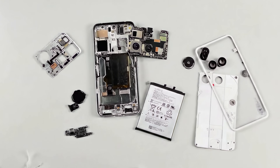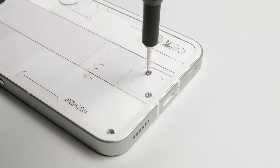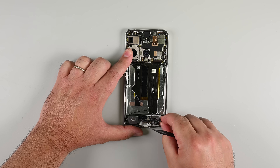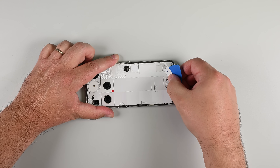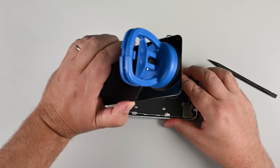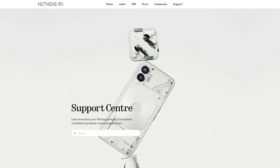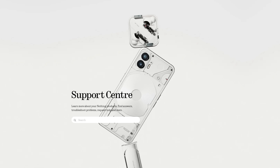At first glance, the Nothing Phone 3 seems like it would be a repair technician's dream. The team at Nothing loves to showcase the screws and components that make their devices, but repairability doesn't seem like a priority — it probably could be, and would align well with their unique designs. On the plus side, we have cameras, a USB-C port, and a battery that can be independently replaced. But on the downside, hidden screws covered by decorative stickers make disassembly visually destructive. The display and rear panel are secured only with glue and no clips, making repairs complex and expensive. And not having manufacturer-made repair manuals means that once you get past the obvious exposed screws, you're flying blind.